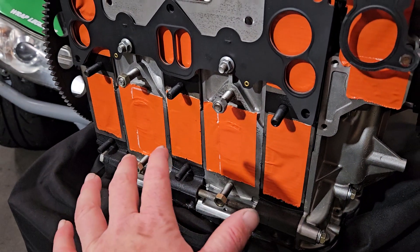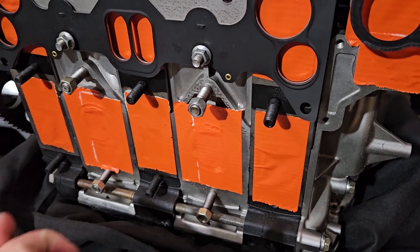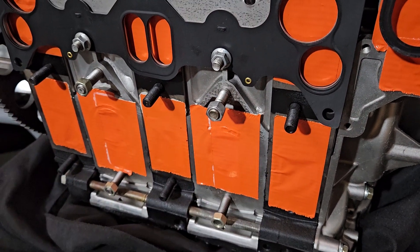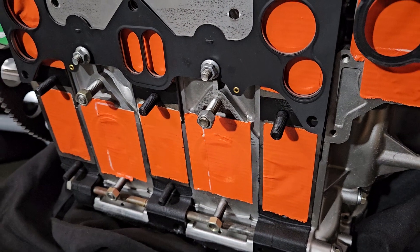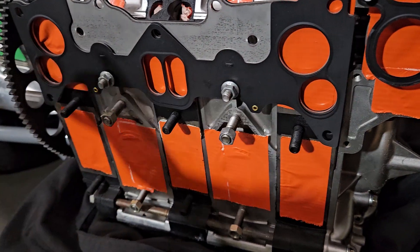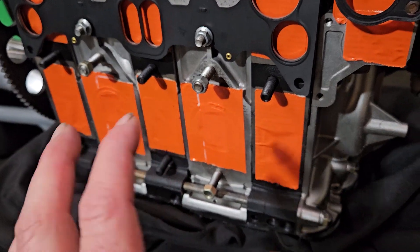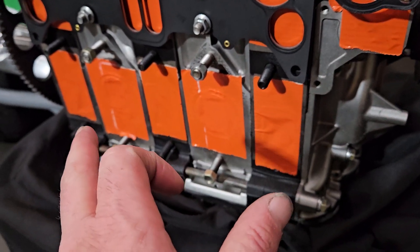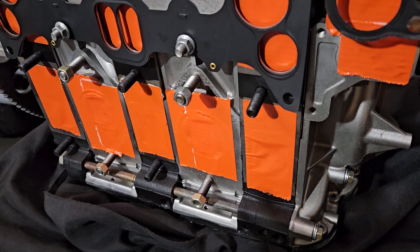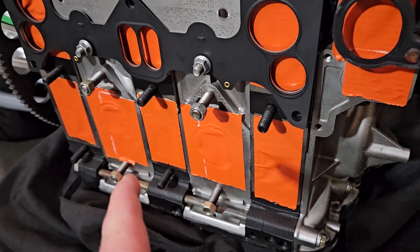I'll also try to get a hold of that OBX Racing Beat combination with the runner tubes. Imagine the simplest design possible: put a Renesis aftermarket header up there, make two jumper tubes, add some 13B flange inserts, flatten it all out and get it going. Obviously that's not going to be the best flow — you want equal-length, really beautiful headers coming off of there. But in a pinch, a rudimentary log-style manifold modification might get these projects up and running, and I'll make sure to show some of those soon.